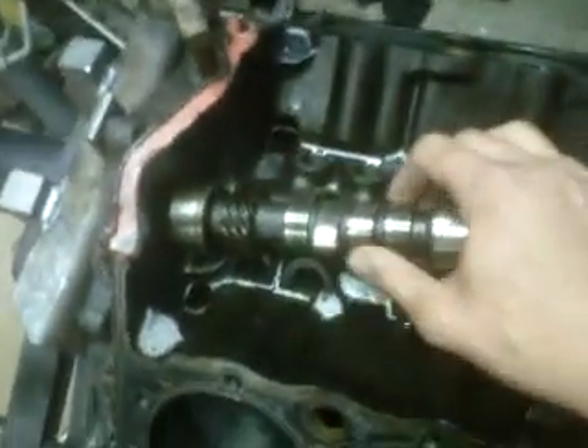Zinc is really really important because you just lose your lobes — there's no way around it. That's what killed this engine off prematurely and it's just not worth it. You might as well just run a zinc additive because conventional oil isn't enough with the zinc levels today.